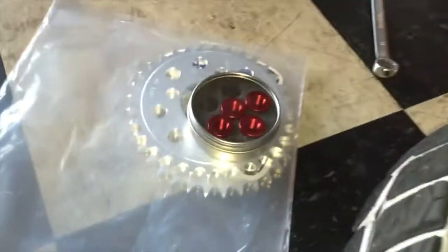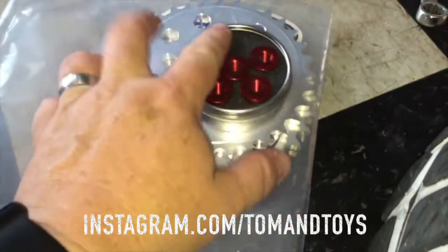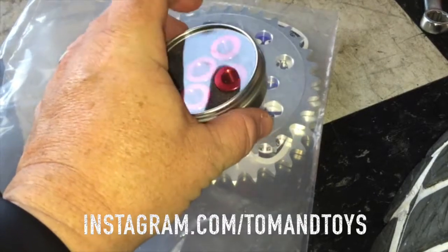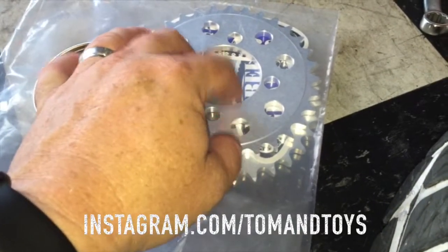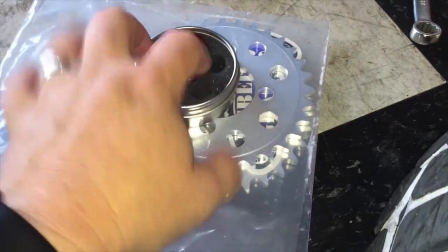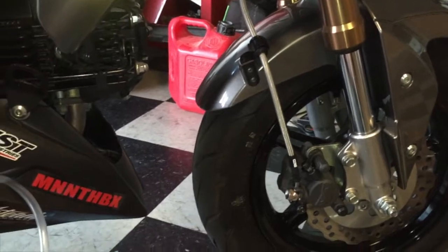So if you don't follow me on Instagram, then you didn't know that I got my Driven Racing rear sprocket nuts and a couple rear sprockets. I'll probably go 32 in the back. I'll probably go down one in the front and two up in the back, just so you know. So I'll be at 13/32.